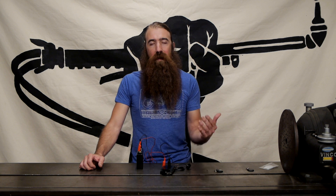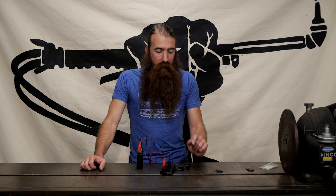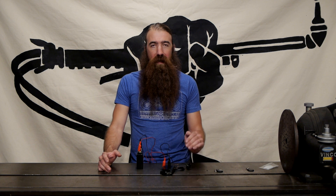You'll never get the bike started that way unless you bump start it. The best solution is to find a larger capacity battery with more cold cranking amps, and that will solve the problem. We know better than anybody that you don't always have space for a bigger battery. If you're on a custom project with space constraints and you're installing an M-Lock with this problem, let us know — we've got a couple of tricks, but they're just a little too complicated to explain in this video.